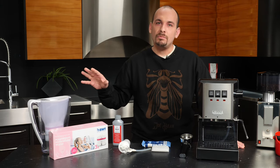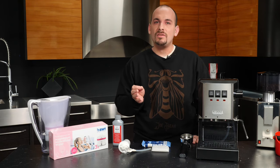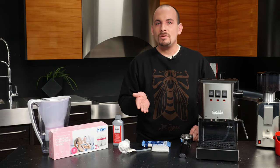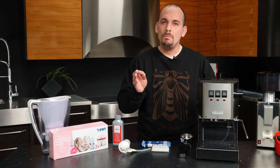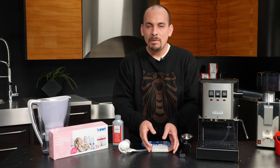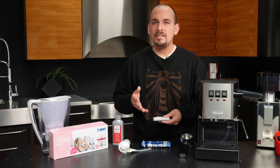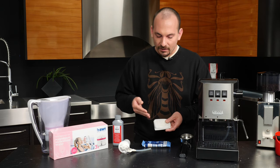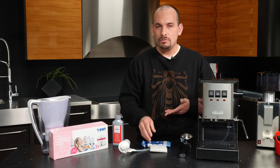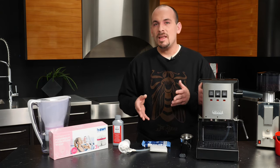I have an assortment from a brand called BWT. Each of these products improves water taste but is also designed to remove minerals that cause scale buildup. Whenever you're choosing a filter for your Classic, you really want to learn about what the filter is removing and if it's actually softening the water. The first option is a pouch-style filter — the most low-tech and basic. It sits in the tank and softens the water gradually over about eight to ten hours. Ideally you'd leave it in overnight and your water would be ready to brew with in the morning. It's a cheap and easy option that you'd replace on approximately a two-month basis.